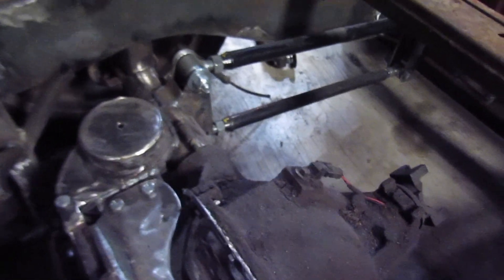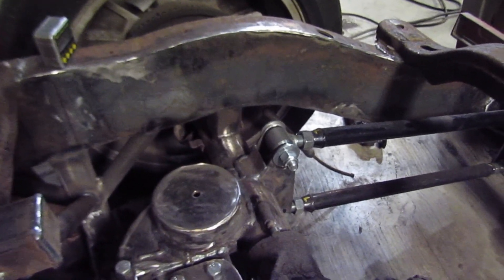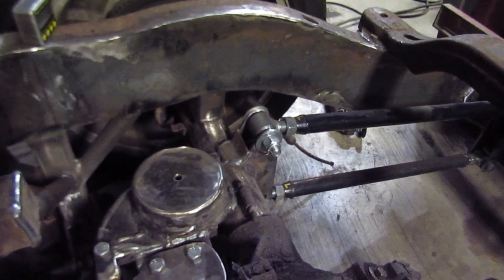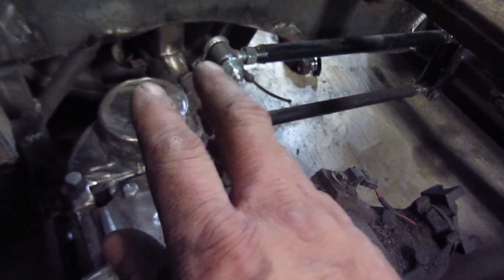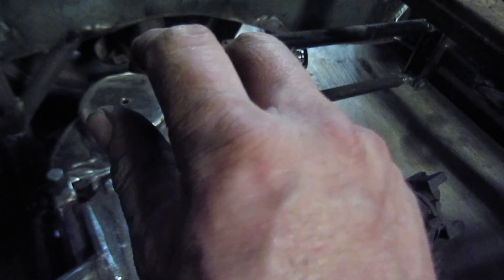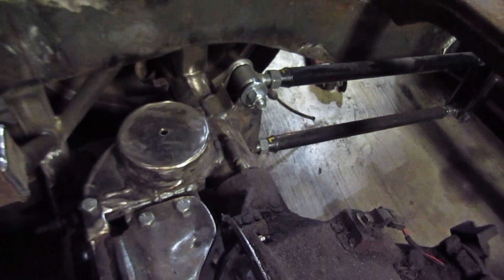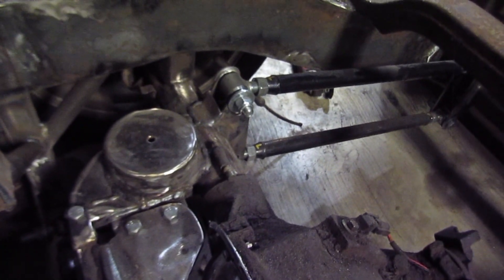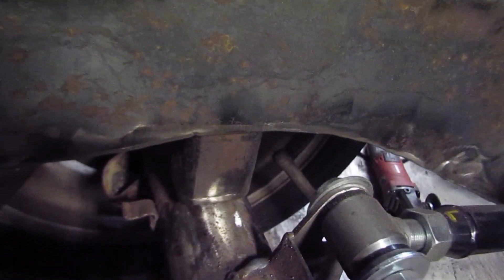When these airbags fail or an airline pops out I won't be dragging the ground - I'll be able to get off the road. Also I'll be able to set it down on this, let all the air out, and this will keep me from crushing that bag. The bag has a lower limit that you're not able to go under, so this will allow me to come down and not crush that bag. That's why we don't want it as a soft mount - we don't want that bag to get laid over and pinched.